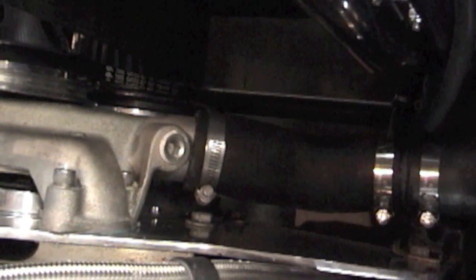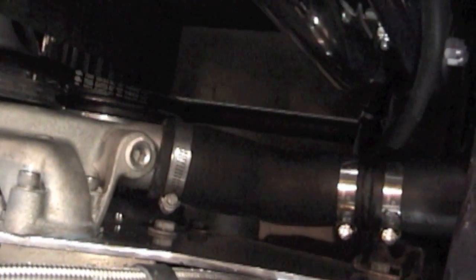Let's talk radiator hoses. That hose down there is an inch and three-quarter outlet. The water pump right there is almost two inches, so right in the middle they make a reducer. You can get that right at the auto parts store — it's a plastic reducer made for radiator hoses, three bucks. That's how you can make two oddball size hoses fit. I'll give you those part numbers in case there are any other hot rodders out there that have to custom make their own hoses to make it work, and I'll give you the upper hose part number too.